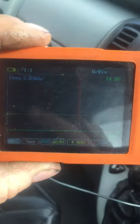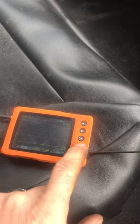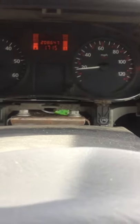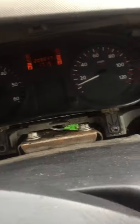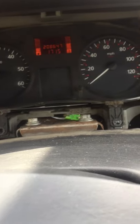We can see a nice signal starting to come. The speedo is back working! It was in limp mode — it wouldn't go over two and a half thousand RPM — now it's going over two and a half thousand RPM. We had no signal coming in, one fault code saying no speed signal, and the engine ECU wasn't seeing it. But it's the radio that's creating the problem.